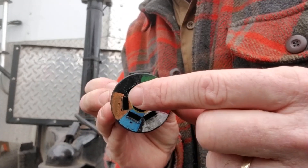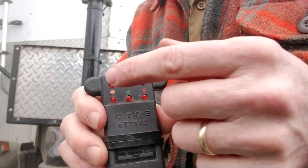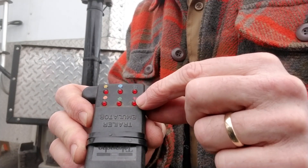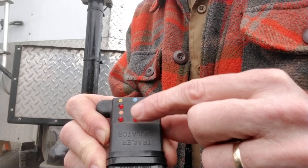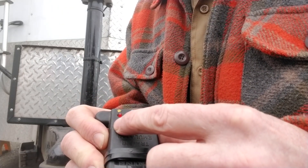This yellow one is a center pin, and a lot of different OEMs use that for different things. I've got one RV where that is my backup lights, and another one where that's just an auxiliary battery charge. On this row, the red wire is going to be a left turn. Then we have our trailer lights, clearance lights, marker lights — called different things. And then we have our right turn.